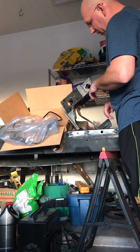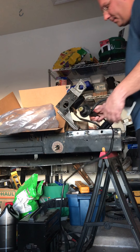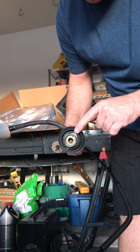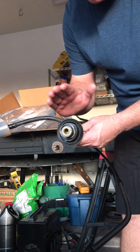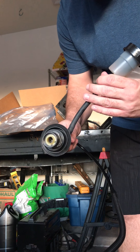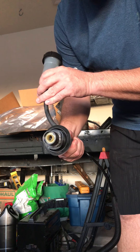However, in order to get this clutch slave cylinder to work — look at it, it's got four ears right here. These four ears: you basically push it in and then turn it and it locks in. So you get it at an angle like this, push it into the bracket, and then you roll it over and it's basically in place.